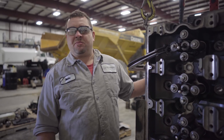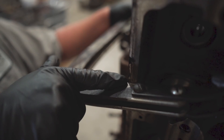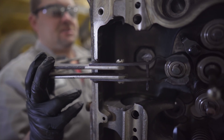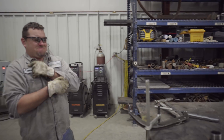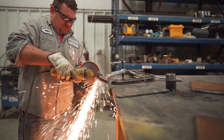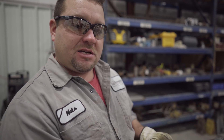We've already run into a problem. The tall sides of this head are not going to allow us enough clearance to depress this valve spring. So what we're going to have to do — like we have to do a lot of times — is modify this tool. The plan is to cut this, drop it down one inch, and reinforce it with a gusset plate. I'm going to drop it down one inch and weld my gusset plate in.